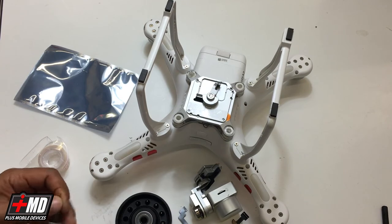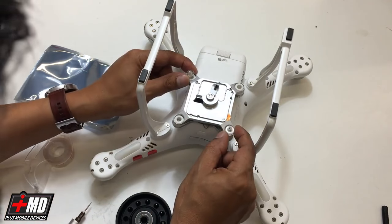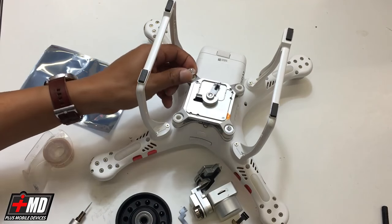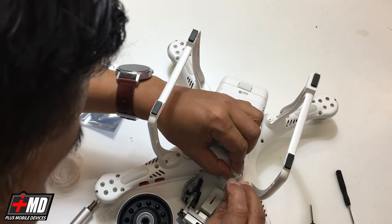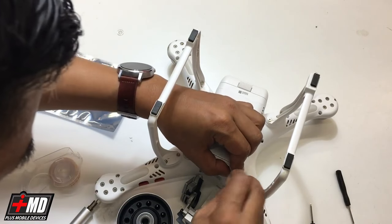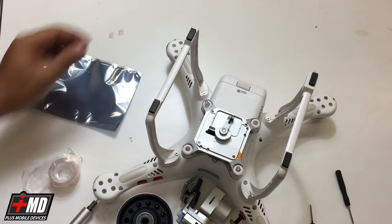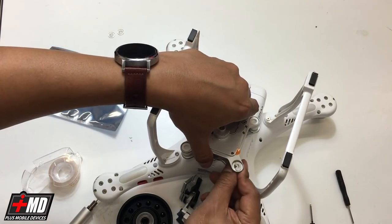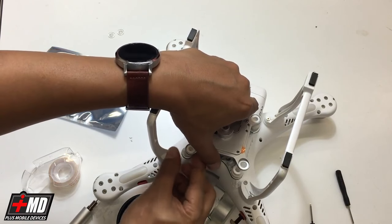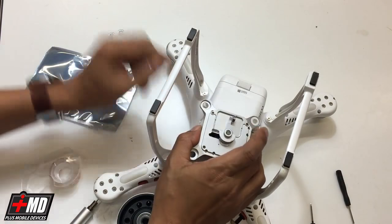What we need to do is remove the gimbal. We're going to take the gimbal off — you have these drop pins connected here. We need to free that, and DJI does provide two additional ones. Once you get the pin fastener out, go ahead and actually loosen the drop shock absorber. Squeeze it, pinch it out.